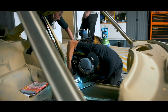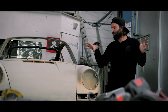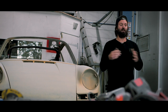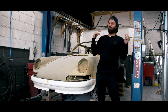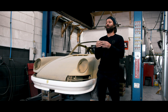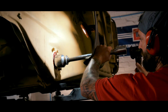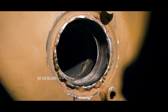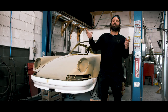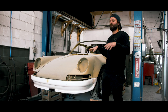Hey guys, Oli here from Golden Barn Garage, welcome to episode 3 on the Porsche ST backdate. Just want to keep you up to date on where we are. We've modified the rear suspension — well, we didn't modify it, we actually put in what was supposed to be there. We didn't have a backing plate where the rear suspension bush went into the torsion bar tube, so we fabricated a piece of metal to go inside there for the bush to push against. That allowed us to get the car onto four wheels, sitting on the blocks.